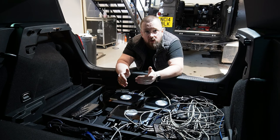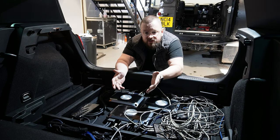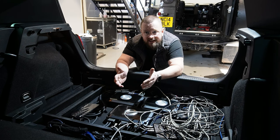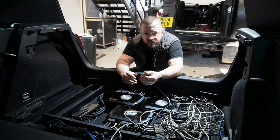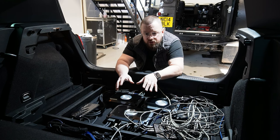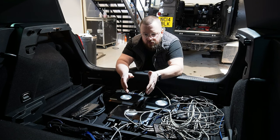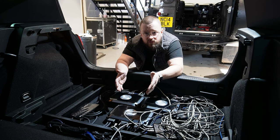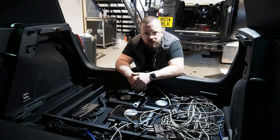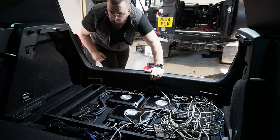And your standard remote triggering — the 12-volt feed from an aftermarket head unit. Now in this car, we haven't got a remote feed because we're running OEM integration. We don't want to run an ignition feed to the amplifier because that can sometimes turn amps on and off pretty hard. So we want signal sensing. To do that, we need access to the DSP suite connected to the amp so we can tell the amplifier we want it turned on via signal sensing. That explains the jump-start we had to do earlier. Now it turns on at the button each time you do something like open a door.